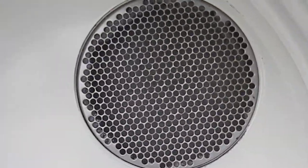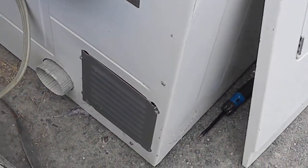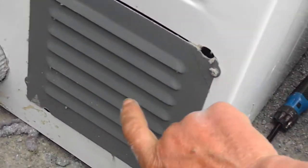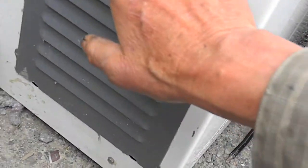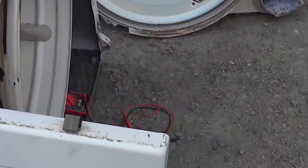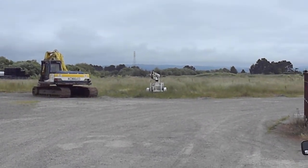These actually have a tricky belt system, so you might want to take the back panel off. Check that there's not a lot of lint built up in there, because that can be a fire hazard and cause it to not heat very well. What I always do is take the back panel off, notice how the belt is hooked on, and draw a little diagram of the belt routing on the back of the machine so I can always remember. So that's your big Kenmore tip for today — hope you enjoyed it, signing out from Northern California.